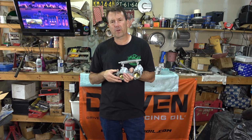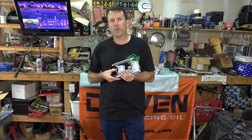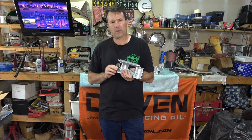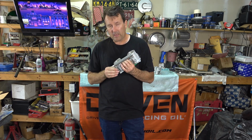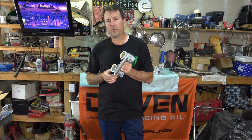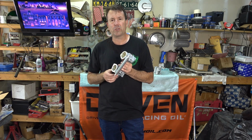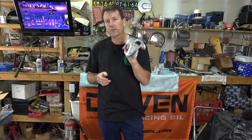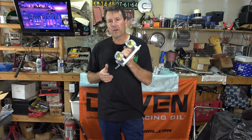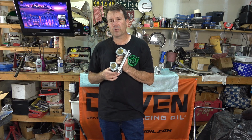I talked with Prescott Phillips. He's actually got a race car that he runs a Megasquirt on. I think it's running a Megasquirt 2. And he was saying that he doesn't use the VE table. He just goes by throttle positioning and RPM for his tuning. So there is a way around that, but I prefer, for a driving situation, to actually go by a vacuum signal.